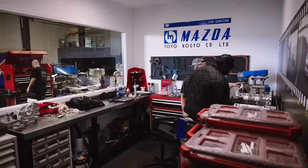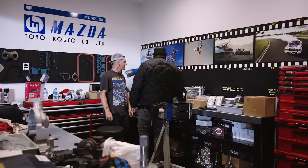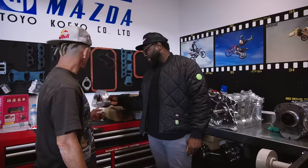This is all nostalgic. NOS factory Mazda MFR 30mm PP. That's probably worth more than that. Oh, and the logo? And then these we actually machined. Two of those is less than one factory rotor. That's lightened and balanced. Are billet rotors a new thing, or have they been around? They've been around for a while, but no one's really run them and punished them. So we're not selling these yet because we're going to put these in a motor. I'm going to punish the shit out of them, and then once I know they're good, then we'll go to sell them.